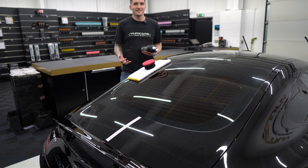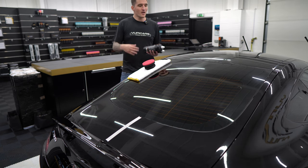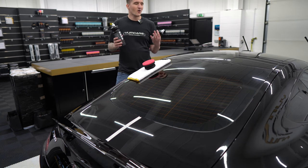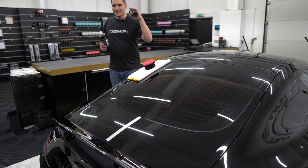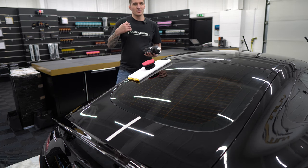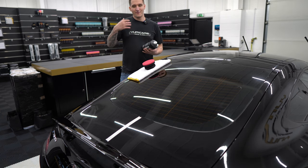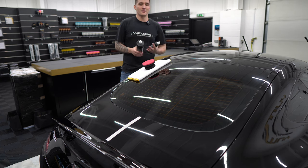We've had the opportunity as professional detailers and car enthusiasts for the last 10 years to use pretty much every compounded polish on the market. As of 2021, my unbiased opinion is the best you can get is from a range called Sonax. Sonax do two unbelievable products: number one is Sonax Cut Max — a compound with a beautiful wipe-off. Step two is Sonax Perfect Finish, which I think is the market-leading refining polish. On the right car it could even be used as a one-step, but because this paint is very hard, we'll be using both.